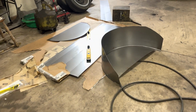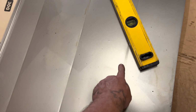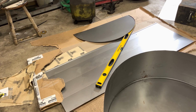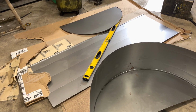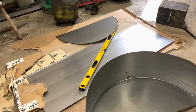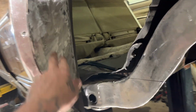The tubs have, you can see how the shininess is. They have this oil, there's some oil on here, obviously, so it don't rust. When you're tack welding, right when you touch it, it wants to pop. So, like I was saying, you wipe that off with a soapy rag with like some Dawn, I don't know. Wipe it off or just use a rag and just wipe the living shit out of it. So that way you get the majority of it off. Look, that shit is nasty. But you'll get it to tack way better.